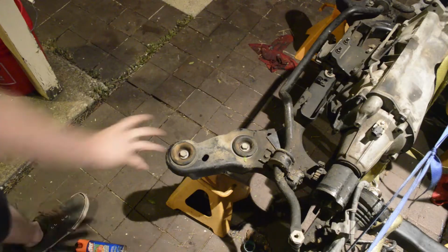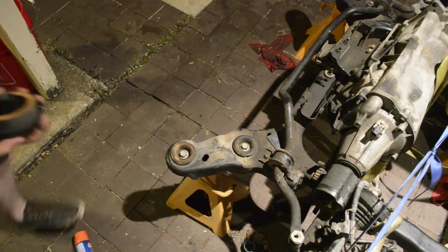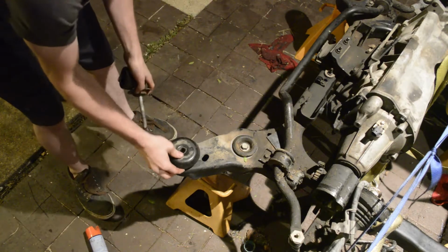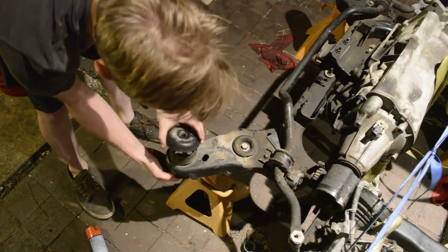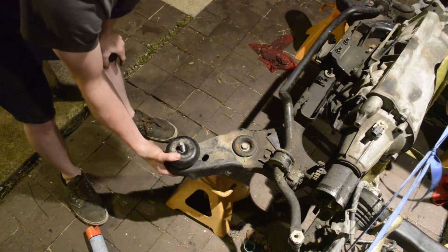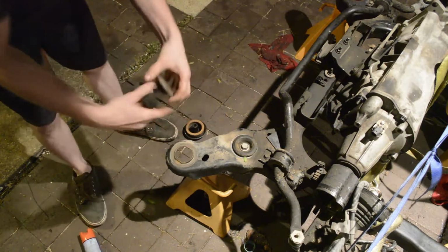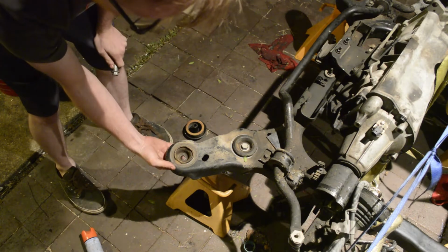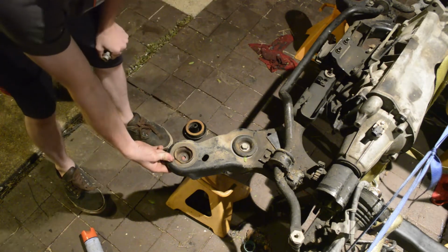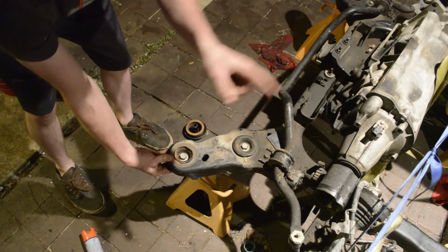Looks pretty good. So one of the issues with these cross members is they normally use a system like this, where it goes through all of these bushings. And obviously, I want to make my car as stiff as possible. So the solution I've come to is I take these little bottom pieces right here, and I actually weld them like this into the cross member, so that then I have a centered hole that I can attach the frame